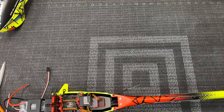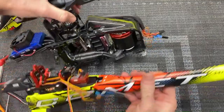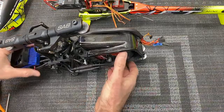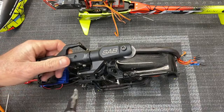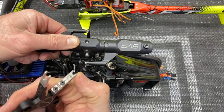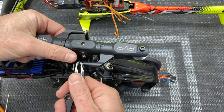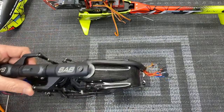Here, we'll use the Comet mechanics. It's pretty bad when the Comet mechanics are the size of the Mini Comet. See? Look at that. Big Comet. All right, so on the Comet mechanics, here's these pliers. Pops the link right off. When you want to pop them back in, flip it over, use that side, and line it up, pop them right back on. These things are really cool.